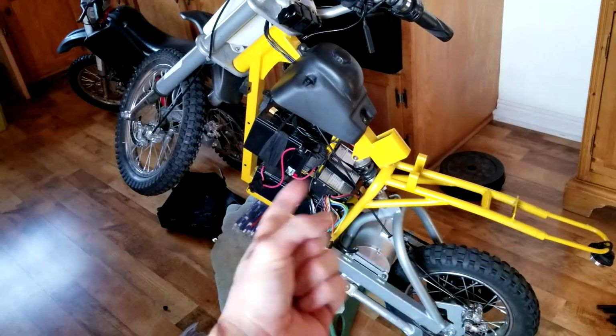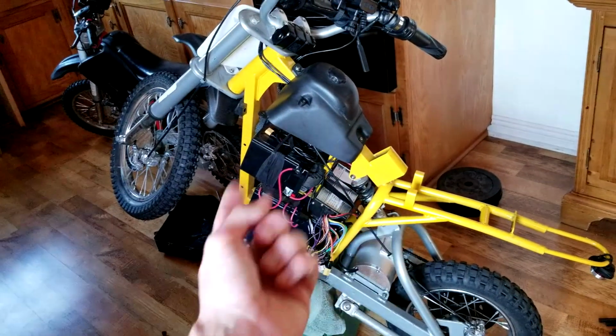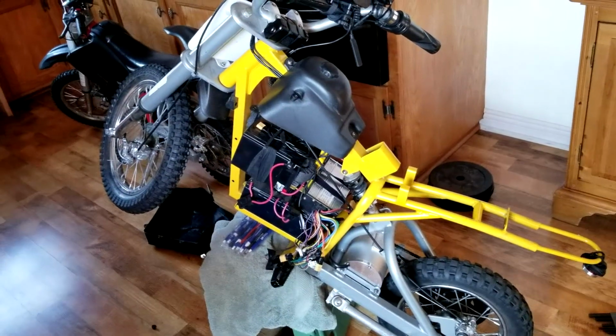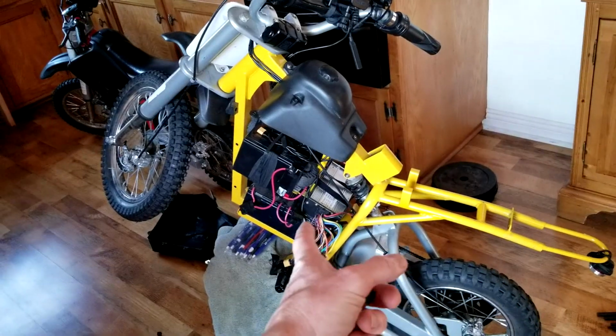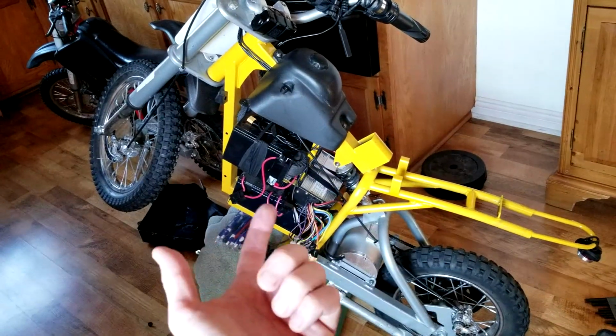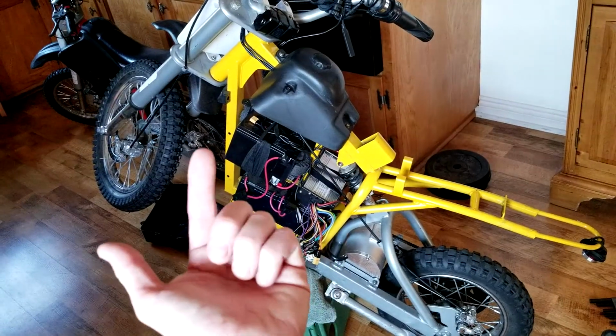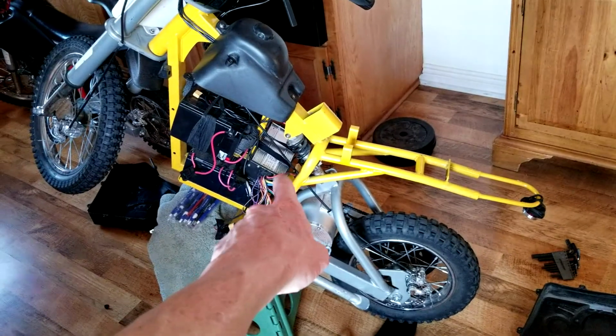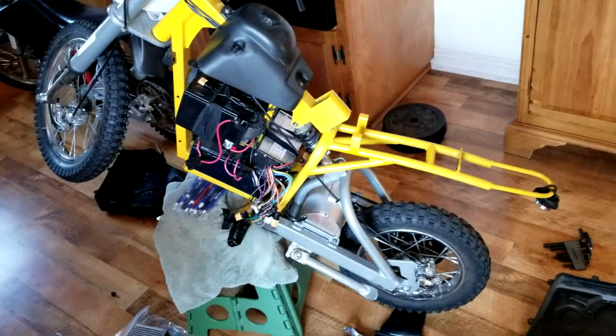If you've come here and you have a 36 volt, still only 3 batteries, definitely check out my modification video. I'm 155 pounds. I go 28 miles an hour. I added 1 extra battery pack, increased all 4 of them to 15 amp hour batteries, with a 48 volt motor and a 48 volt, 1800 watt controller. I'll have that video linked below.